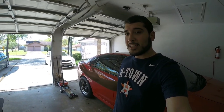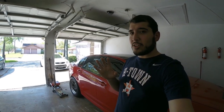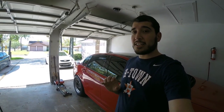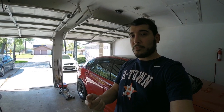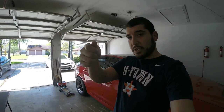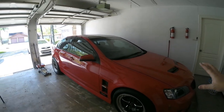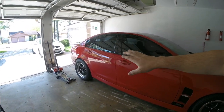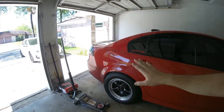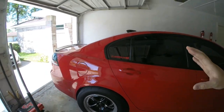So what's your option? There's a new type of cutout that's been coming out — it's called a vacuum or boost activated cutout. Basically what it does is it uses either a boost reference or a vacuum reference to open and close the cutout. So essentially if you have a boosted car like this one, you could have your long tube headers running through your midsection and into some stock axle backs.